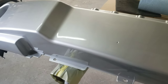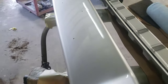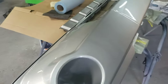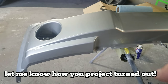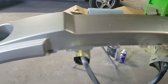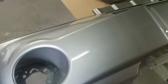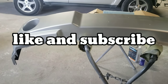You can look at it and it has a nice finish, nice gloss — has a little bit of dust in it but that's not a problem, that can be sanded out. The finish gloss is nice, the shine is nice, the metallics laid down nicely. I didn't get to show you in real speed me clearing this, but it's really similar to spraying the base coat. Most importantly, pull the trigger off the panel before you start clearing — that'll keep you from running it. Even with an aerosol can of clear, don't pull the trigger right on the panel. Start off the panel, overlap 50%, and you should be fine. Appreciate each and every one of you watching — please like, subscribe, and share this video, and we'll see you next time.